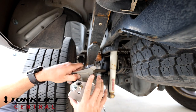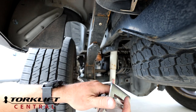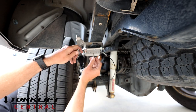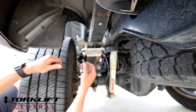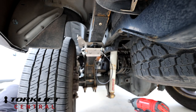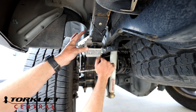My pilot holes are drilled. Next you have to install this part, but you've got to put the little bolts in first. Drop these little lock washers into the hole, slide this up on here, and then you have these set screws to go into those divots that you drilled. These liners wrap around the rest of the leaf springs in case they were to fall off — they're not going to just bounce down the highway. Get those centered in there and hand-tighten. You can see the way this thing works — it slides into that hole to give you more stabilization in your leaf spring.